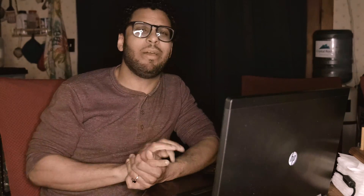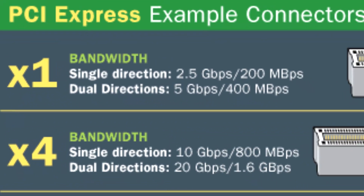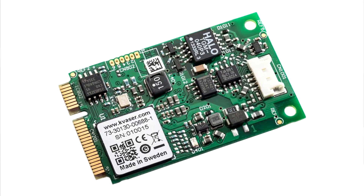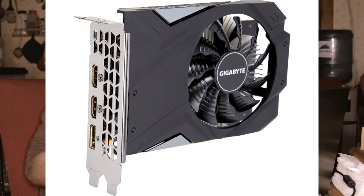When it comes to choosing a graphics card for the eGPU adapter, I highly recommend that you don't choose anything too powerful. Don't look at getting an RTX 2080, because you'll buy it and realize it's not performing well. The eGPU adapter is limited to PCI Express 2.0 at 1x, which doesn't allow enough bandwidth between the graphics card and your computer, plus you have the overhead of the mini PCI Express or ExpressCard connection. I personally recommend a mid-range graphics card with no more than four gigabytes of RAM and probably a 128-bit memory bus.